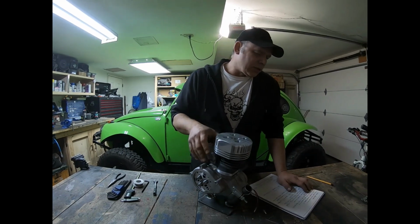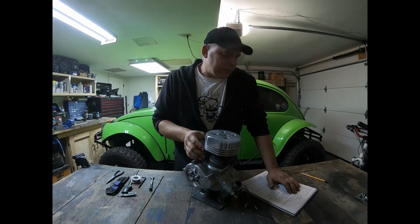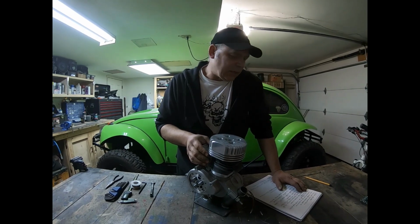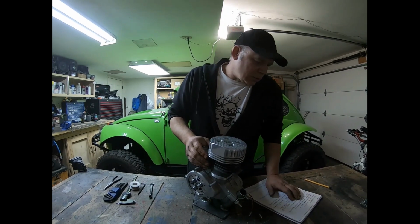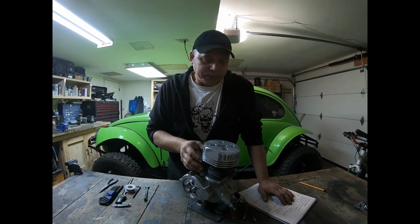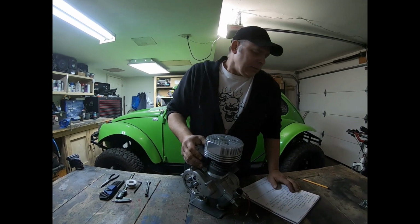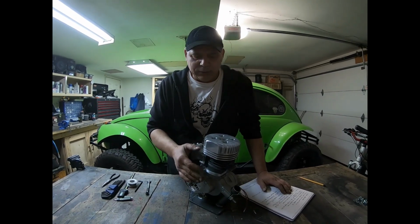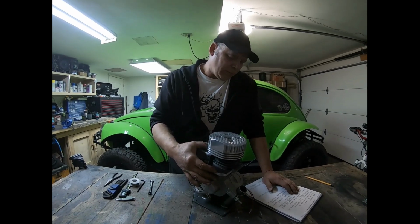We trued and balanced the crank. It's at 60% over rotational mass. We ported the cylinder; the exhaust was at 178, 34 millimeters wide. The transfer is at 128, which equals about a 19% blowdown. Targeted RPM is about 12K. The case was port matched at a 25-degree angle to the spacer to not remove too much volume in the case.